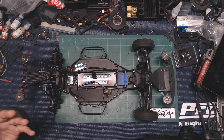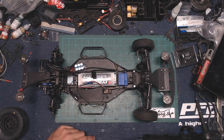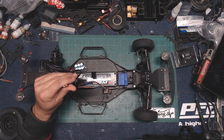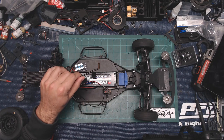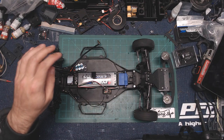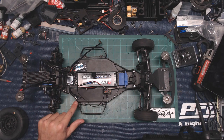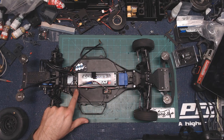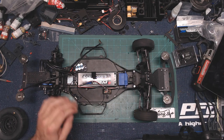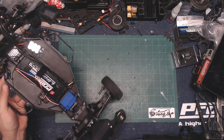It does come with a fan if you want to use that — most people don't. This ESC is really chunky, it's a lot heavier than my Hobbywing, which is kind of amazing. Nice thick gauge wires. You don't get any kind of plugs, so if you want stuff soldered, I use the Direct Connect solder plugs to go into the battery. If you're using XT90s, you're all good. It comes with a pre-soldered cap pack. I've got the power button over here, the receiver wire, and another connector for the actual module itself — it doesn't plug into the micro USB, and all of them are labeled.